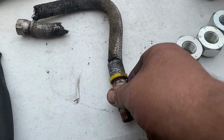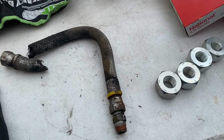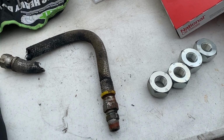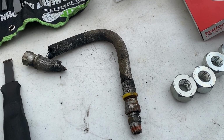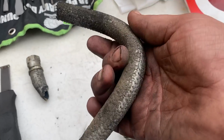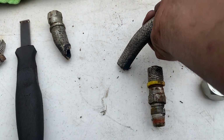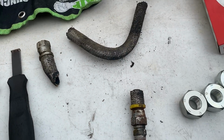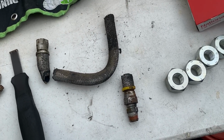This is the first hose for the air compressor. Runs to the air compressor underneath the exhaust manifold. This is the Achilles heel here. This has destroyed a mini Wanderlodge engine. It's very brittle. It broke off into 3 pieces just from Tyler trying to get it out of there. It feels, it's not rubber anymore, obviously. It's just completely dry rotted, shot. Needed to be replaced. It's gonna go out anytime.